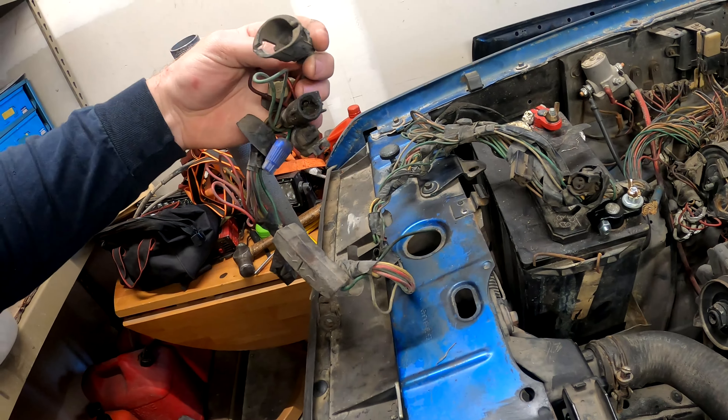Back to the motor — it's a 2.9, and I don't think this distributor will work. We've got to pull the whole timing cover off, everything up front, and figure out if the chain and cam are all lined up, because it is just so far off. It just isn't running right. I mean, it runs, but as soon as you put it under load or open the throttle, it starts spitting and backfiring up through the carburetor. The valves and compression test were all great — it's just something else going on that we haven't figured out yet.